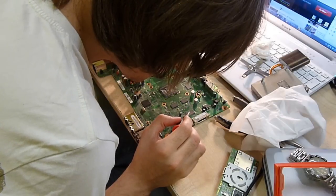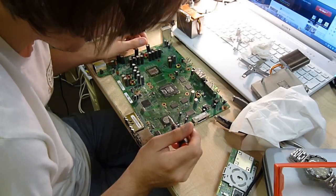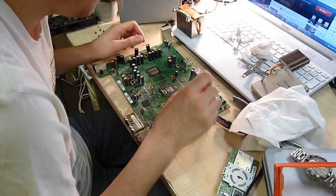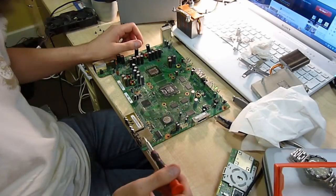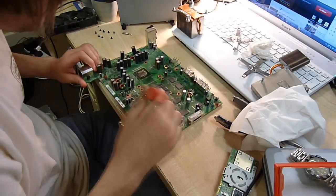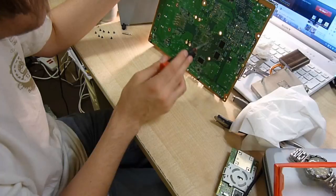This is a flash chip, so that will be your ROM. That's your hard drive connector. This is probably their equivalent of a southbridge in this thing, which will do all the major interfacing. Looking at where the traces go to the USB - a few to that chip, a few down there, a few to this - which goes to your USB and network. So yes, this is essentially your southbridge, linking to all the peripherals around the device. It also goes to the GPU.